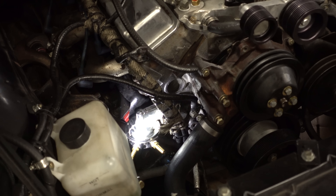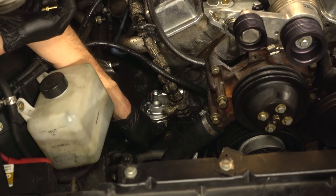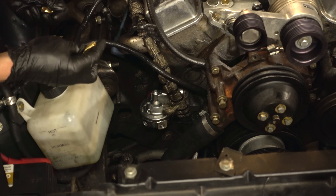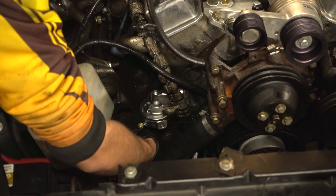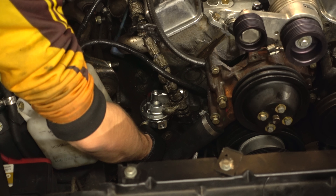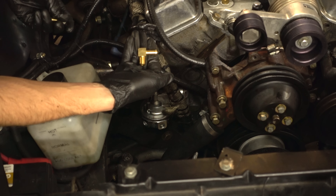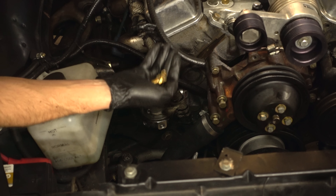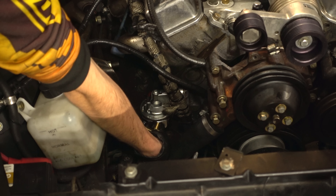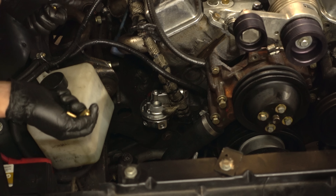The fuel pump is mounted — just need to plumb the hoses to it. Immediately after putting these barbs into the fuel pump, I took them right back out. The radiator hose is now too close to where this exits, and you do not want to heat up your fuel. The angle on this fitting is also pretty awkward, so the fuel hose would be maybe kinked and I do not want to risk that. I got two of these 90-degree fittings — it's not amazing for fuel flow, but I really don't think it's going to be a problem. I'm going to install the inlet one right now and put a little piece of hose connecting the fuel pump to hard line, then wait on installing the second one until I have the alternator in because I need to see where I can route it safely.